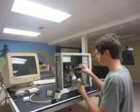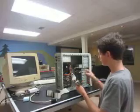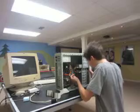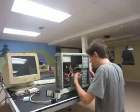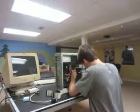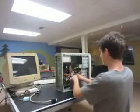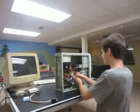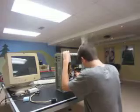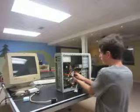That's if you want to have another optical drive, if you connect this end to the optical drive, or another hard drive if you connect this end to the hard drive. Doesn't matter how you connect it. Once again, they will only fit one way. And now you can connect your second one. This is what's going to be transferring the data between your CDs if you put them in the optical drive, or your saved data on the hard drive.